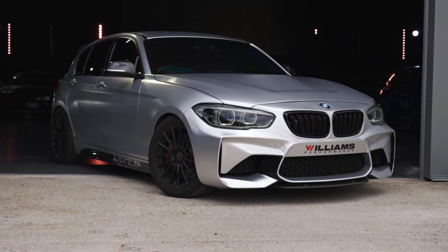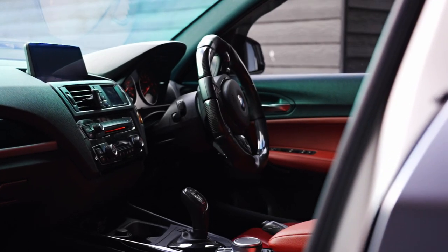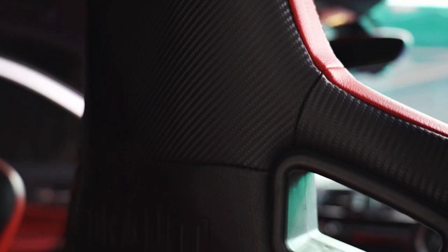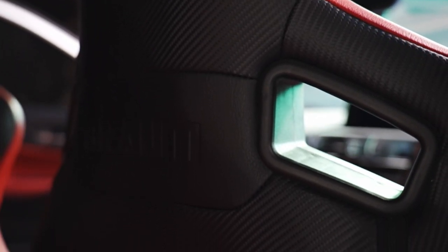You'd estimate horsepower to be 900-ish? Yeah, it does about 900, 800 at the wheel. Today we're on about maybe 750-ish. We're on E40 blend. And has it got a pump map? Yeah, we've got a pump map as well - that's still in the fours. Today we're probably mid fours, and I hope to see the car in the threes quite soon.